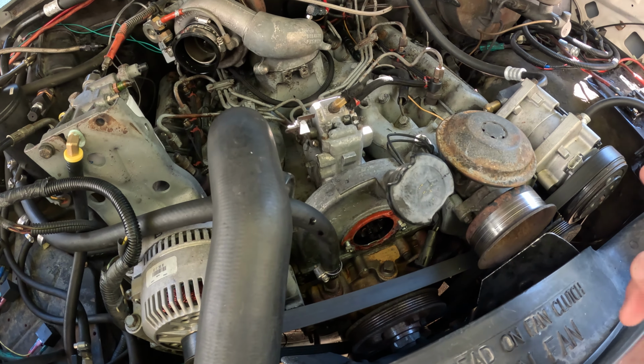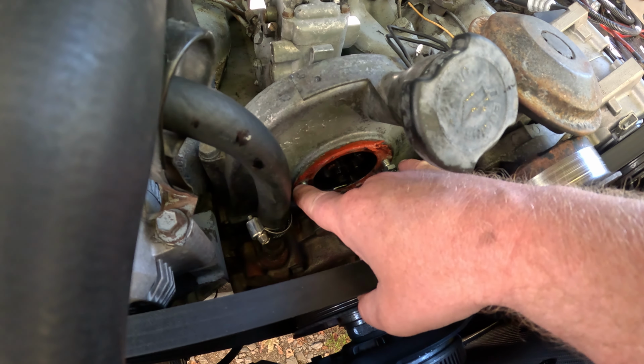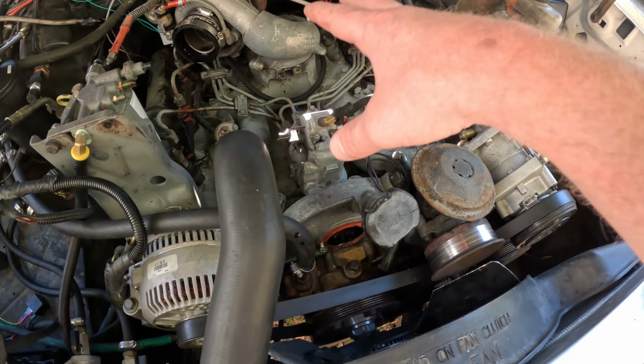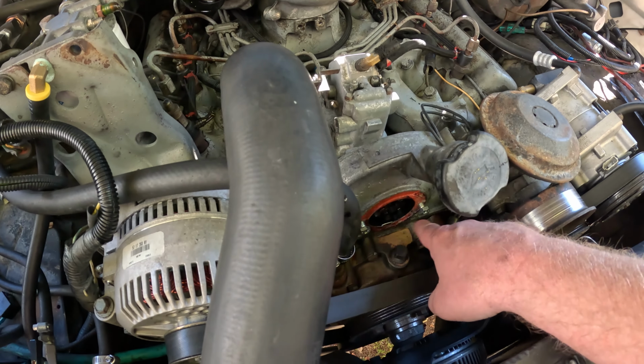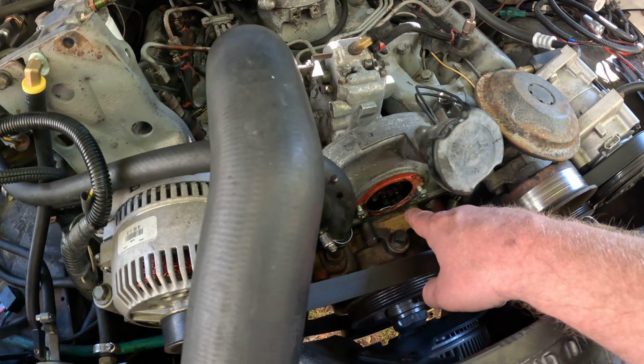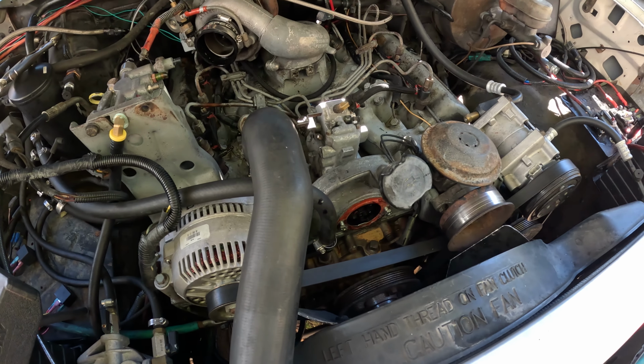We have removed the cover on the front, and I've taken two slightly longer bolts than the factory ones, ran them in and snugged them down against this gear so this gear won't turn, and hopefully that will be enough to let me take this cover and pump off, clean that bottom of the housing and clean the block really well, get a good coat of RTV on it, and get this put back in place without disturbing the timing. We'll see how it goes.